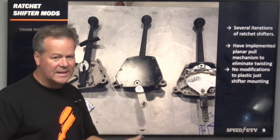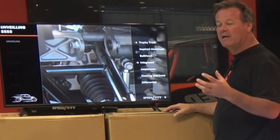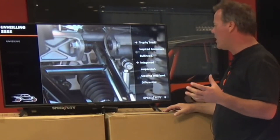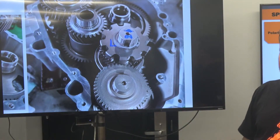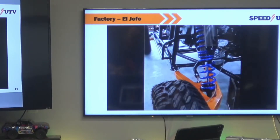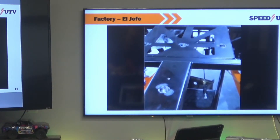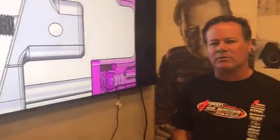Double shear top and bottom — back to our same double shear program. Steering rack is double shear. Nice big forged 7075 upright. Everything is double shear: tolerance bearing widths, support bearings, double shear components, sway bar double shear, spare tire mounting inside the bed — everything is in double shear in every location.